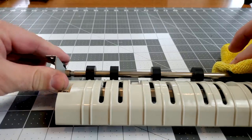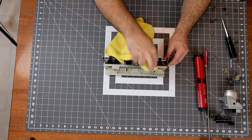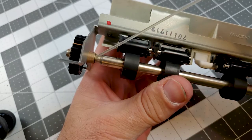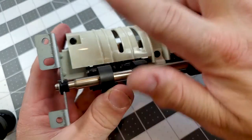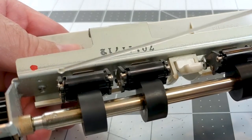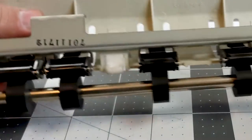This is also typically the cause of a lot of squeaks. Generally you want to put a tiny bit of lube, like Triflow, on brass bushings, but leave plastic bushings alone — they do not need to be lubricated. I will also lube the ends on each exit roller, as these are a very common source for noises.